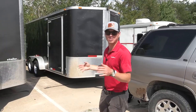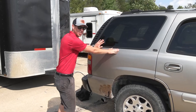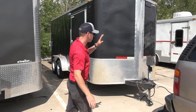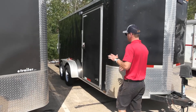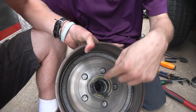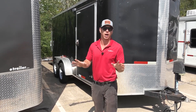Last time what we did was just make sure it was safe. We made sure that the vehicle, my Tahoe, could handle it and she's good. We made sure we had a brake controller - it already had it installed. We went over the brakes, made sure they worked. We also did a little adjusting with our hubs, made sure the bearings were good, the seals were good. The brakes work, we're safe. The axles are good, thank God.